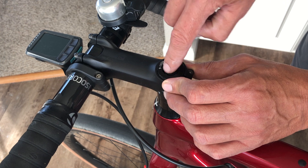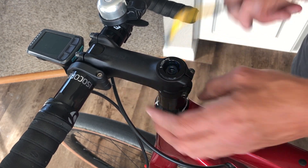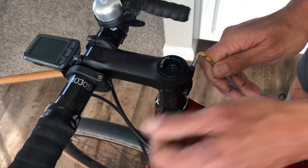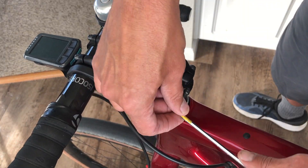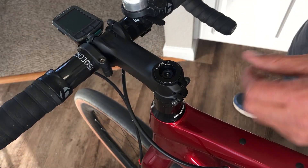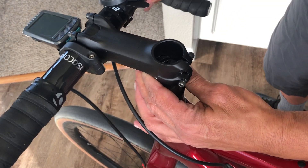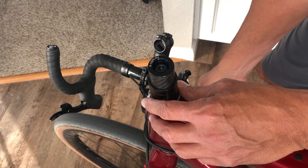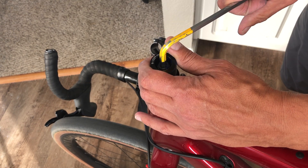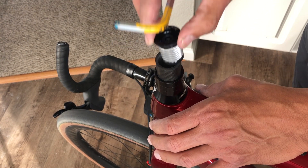There's basically a little bolt right here that looks like it's got maybe a six millimeter. So what I'm going to do first is undo the stem — I like to alternate back and forth so we don't stress out the stem. At this point the handlebar and the wheel are loose; I could just pull the stem right off if I wanted to. This is what they call a compression plug. As we break that bolt loose here, this thing will come out.